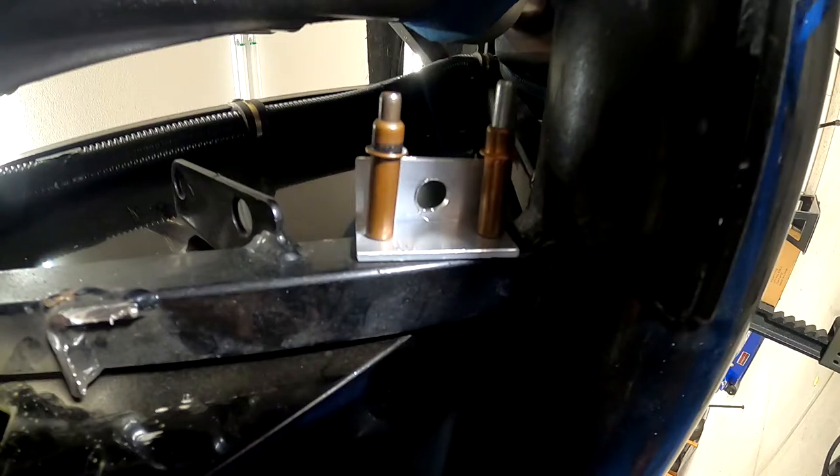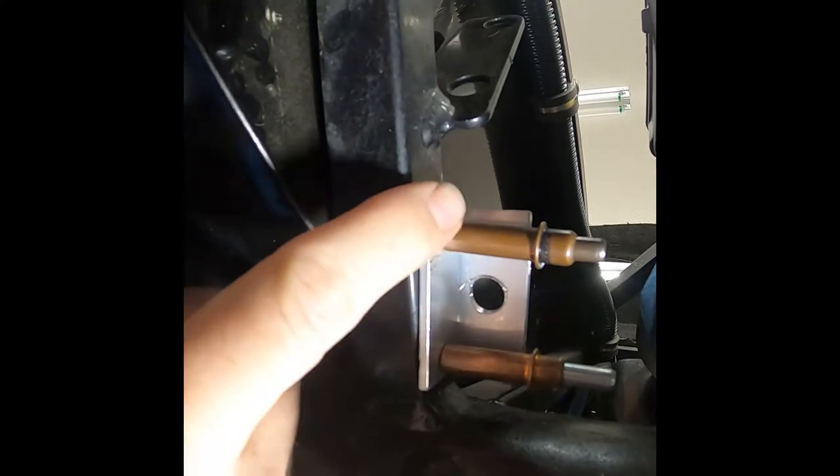This is the shorter piece of the two aluminum pieces. You drill a hole right in the middle of it — as you can see, it's sized for the cable end of the linear actuator. You've got to mount this thing at as much of an angle as you can get. It doesn't have to be exaggerated, but as much angle as you can get. Then get that rivet in place and that's what we're going to do next.